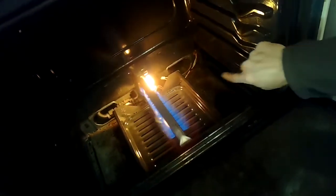It looks really good. We have a nice blue flame — a little yellow tinge is okay. If you have a mainly yellow flame that wouldn't be good; you'd have to change the air-fuel mixture. But this looks good.